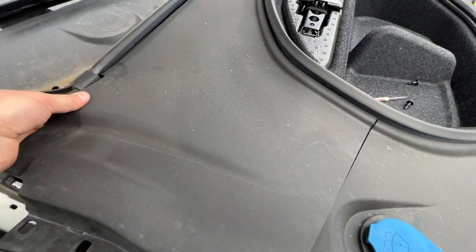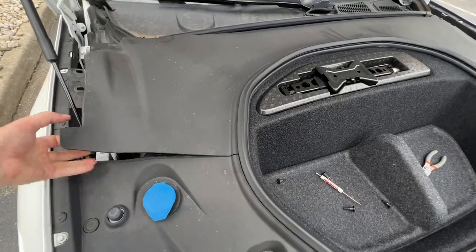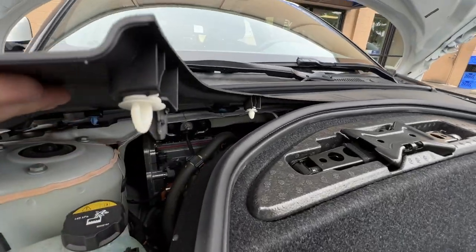The pin can go up and down from flat. To reinsert, you want the pin head sticking up, push it into the hole, and then click the head flat. To remove, push the center down and then they loosen up and you can pry it out. Pretty easy — should just be four of those. Then you can remove this panel; just a little bit of force, work your way around, it should come right off. Just a few clips like this inside.